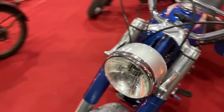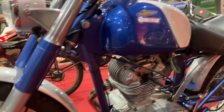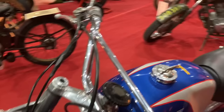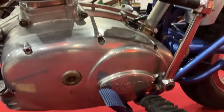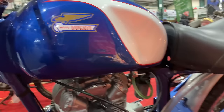The chassis was an open cradle, which used the bottom half of the engine as a stressed member, which helped keep the dry weight down to 132 kilos or 291 pounds. Typically for the period, the brakes front and rear were of course drums, and were of very good quality, as was the rest of the general design. This was a high quality machine available at a premium price, because Ducati was not the volume producer that it is today, and produced machines in tiny numbers. Even though it was produced between 1962 and 1974, only 12,000 bikes were ever built, making this a very rare and very desirable beast indeed.